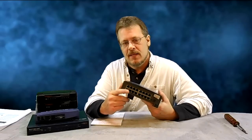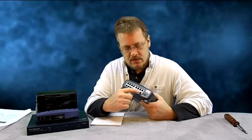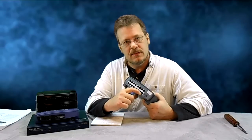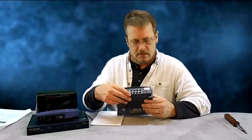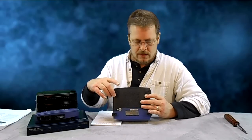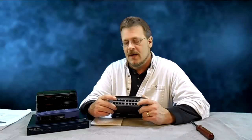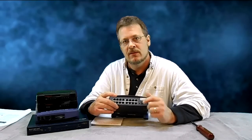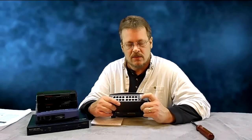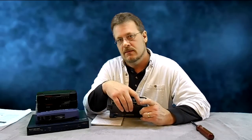You can also piggyback these together so that you can have multiples. The way that you do that is you can come out of port 16 on this one. There's a little switch on the back that you can push in with a pen, and it'll change it so that you're able to hook more than one box together. Either that or you can make a crossover cable if you don't have one of these switches. It's called a link switch, and if you push it, you can just use a regular cable rather than a crossover cable.